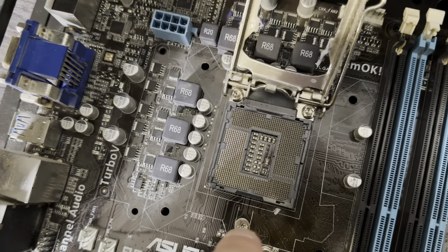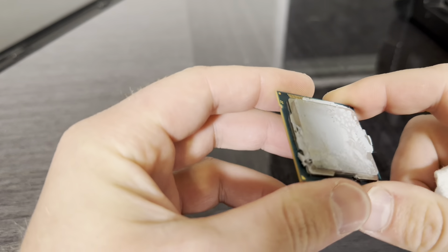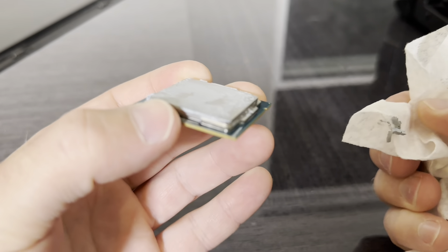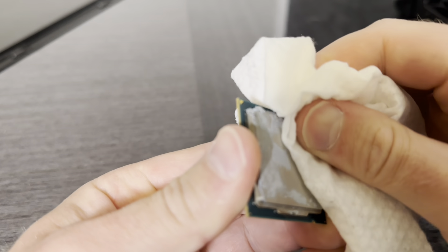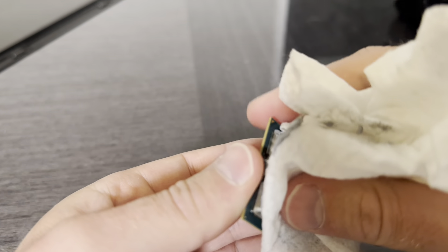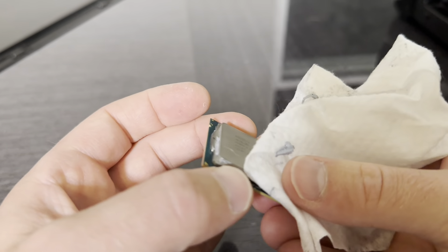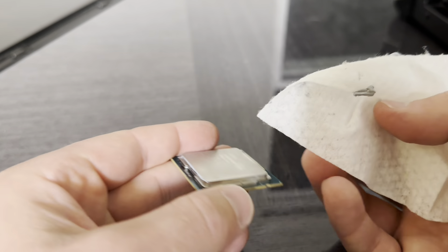I have the pins on the motherboard. I'm going to wipe it out now — I'll just use baby wipes. The paste is quite old. This Intel CPU does not have pins on the back, so it's easier to wipe everything. It was a bit too much paste, but some people say more is better than less — you've got to balance it right. The first time I put a little too little, the second time was just right, and the third time I put a little too much.